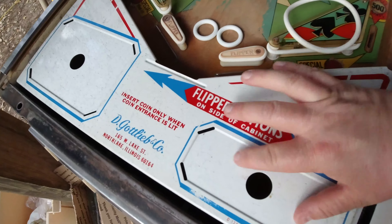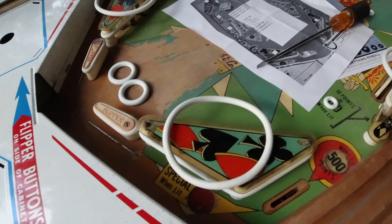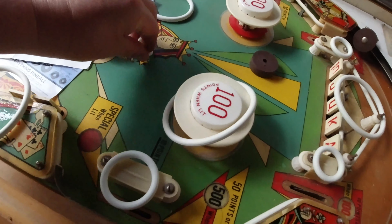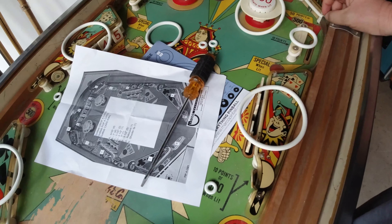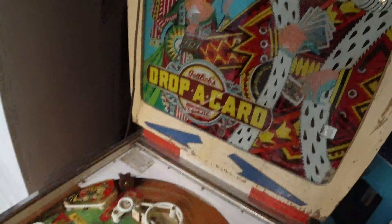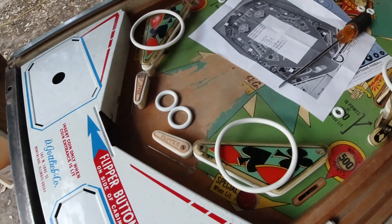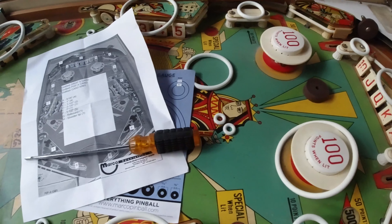The battery died — what I was saying is I need to print the actual instruction cards for this game. Tonight I'm going to replace all the rubbers and the spring, then figure out where these two parts go. The main thing is still figuring out how to address the artwork on the front. The reels are still getting stuck, but I went ahead and put some sandpaper on the leaf switches to try to make a better connection. Little by little — the weather is really nice right now so I'm going to keep on working.